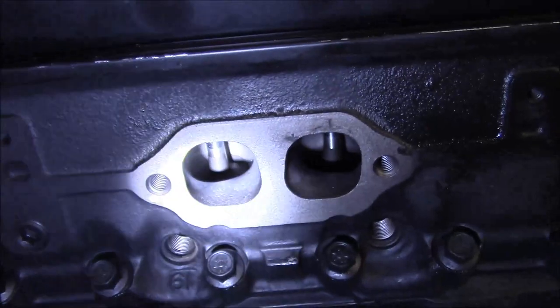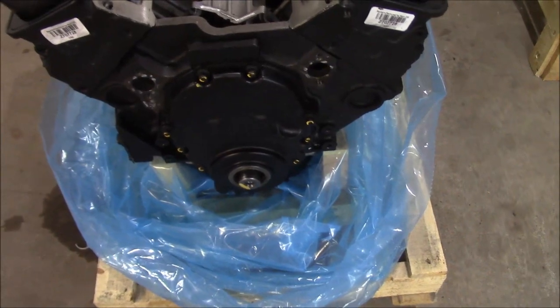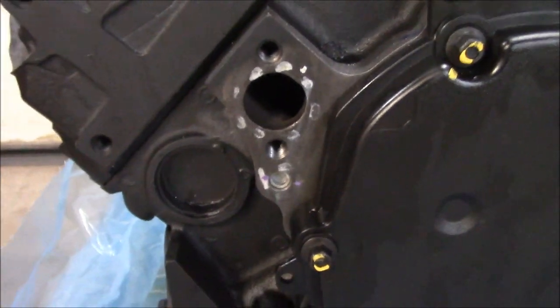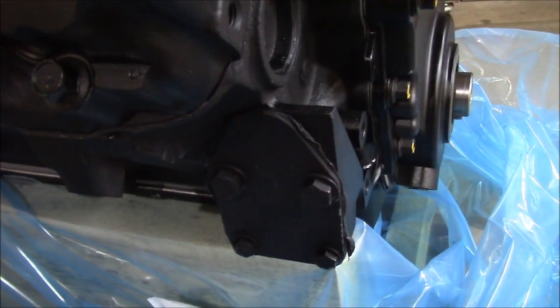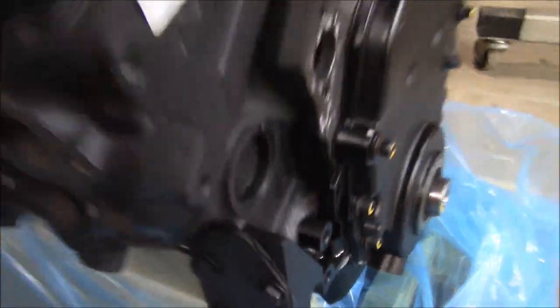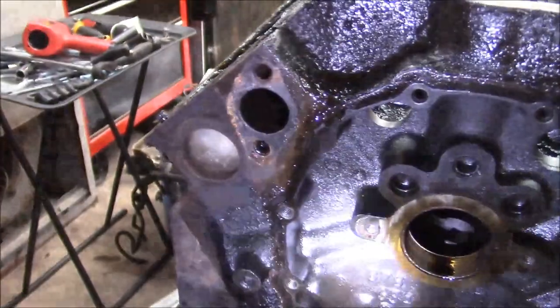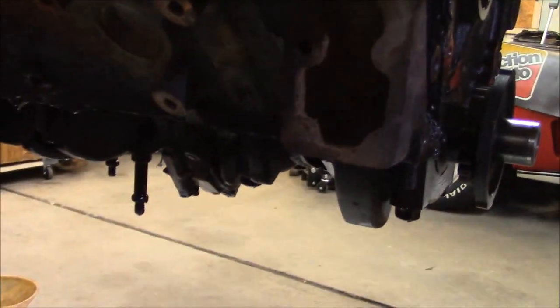Exhaust ports — same thing, not rusty, valves look good. Probably should throw some plugs in it just to keep things clean. It doesn't come with a harmonic balancer or flex plate or anything like that, just so you know. There's the water pump bypass — looks like it's plugged, no big deal. It is machined for a mechanical fuel pump, possibly, because it has this cover on it with sealer and a gasket. This is a Vortec block, and it doesn't even have a pump bypass drill or the fuel pump machined.